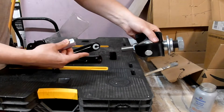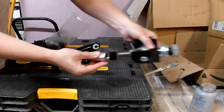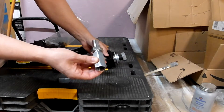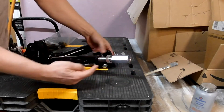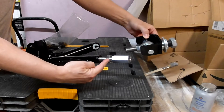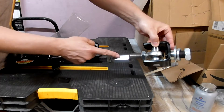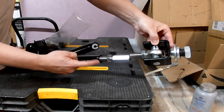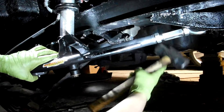It's not like a double-threaded nut as you would see on tie rod ends when adjusting toe in and toe out. This is actually one piece with left-handed threads that goes into the lower control arm assembly, and then right-handed threads on the second half. There's a lock nut on there that also has left-handed threads. That's how you adjust the length to make sure your lower control arm is in there correctly.